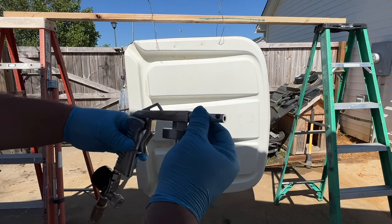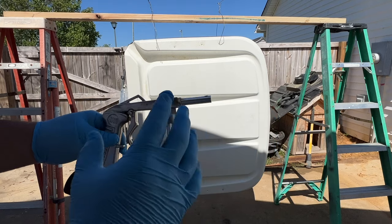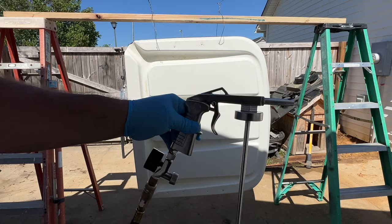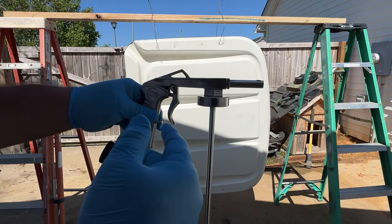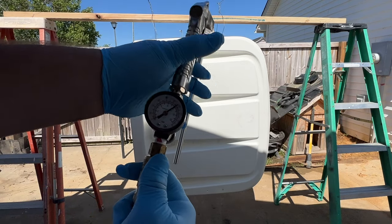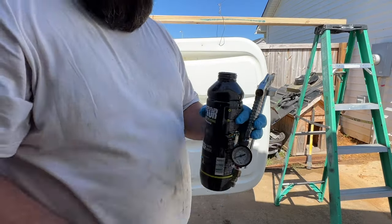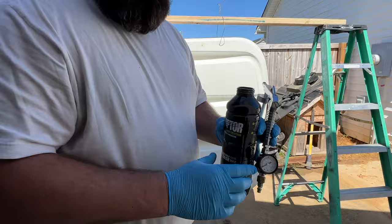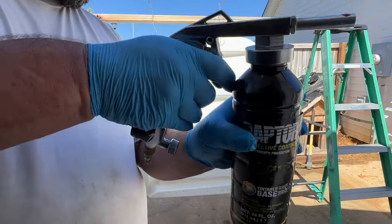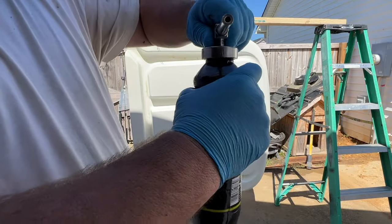This is just your basic gun. It really doesn't have an adjustment tip on it — some of them have adjustable tips, which helps you shoot a little bit finer or whatever. Generally you can just adjust closer distance when shooting or longer away from shooting, and you can adjust the air pressure as well. Our air pressure right now is set to 40 PSI. You load it just like that, tighten it down, and it's ready to shoot.